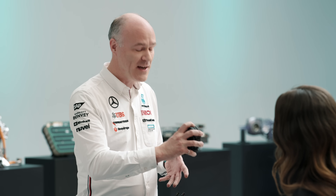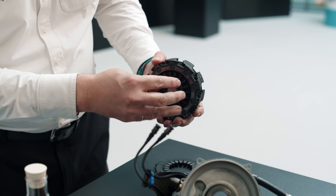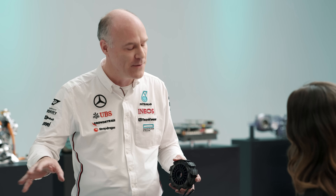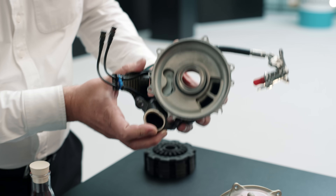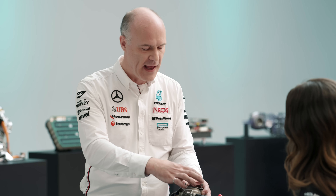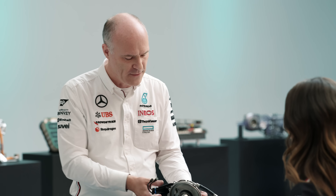These are driven by the engine, so on one side we've got the engine driving those at up to about 15,000 RPM, and then a series of plates in between those with a central spline that's transferring torque through to the gearbox, allowing us to put that torque down to the ground during race starts. Finally, what allows us to make that clutch do that work is the hydraulic actuator — transferring pressure and fluid into the actuator, decoupling the springs that hold that clutch tightly clamped, and carefully modulating the torque directly under the driver's control.